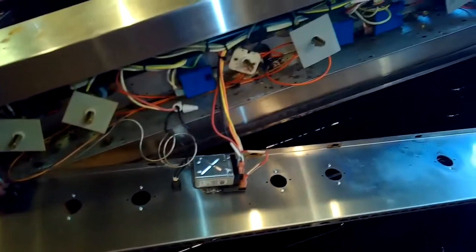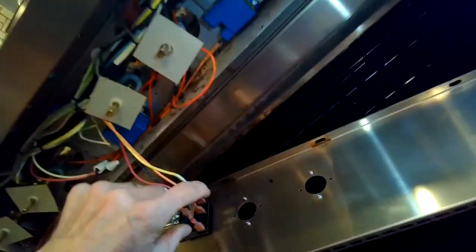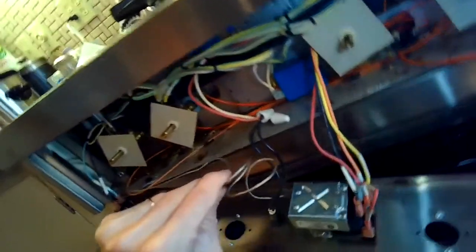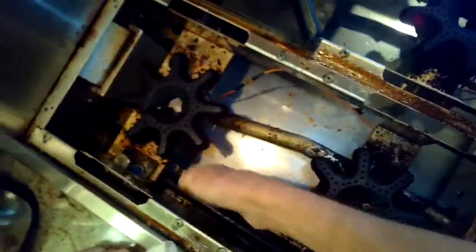Don't worry about the colors of the wires because on the new one everything's color-coded, so it's pretty easy. You can pull off these wires - take a picture if you'd like just to make sure you remember how it was put on. There's the old bulb - it goes out to the left hand side, routed into through the firewall, then into the burner cavity and then down into the oven cavity through a little hole. There's the old bulb. We're going to pull off the clips by pinching in and pulling towards you - those clips are holding that bulb in place, there's two of them.